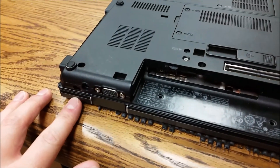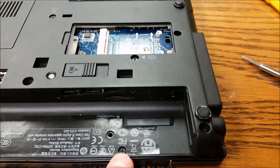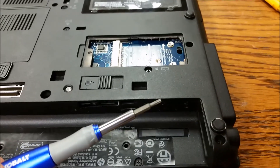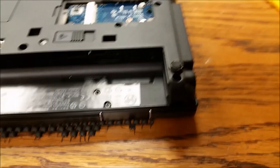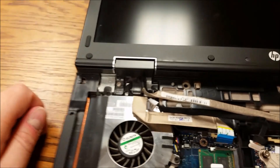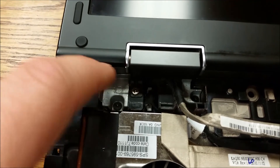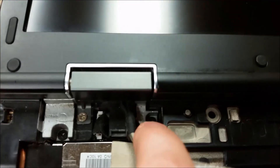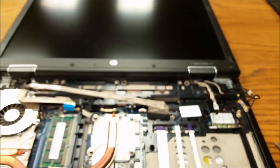Now that we've got this screw and this screw removed, we're going to get rid of this guy and this guy on the bottom here, and then use this Phillips screwdriver. Now since we're in the nitty gritty, get yourself a T8 Torx for these screws right here — I used them over here too. Once you've got the screws on the bottom out, flip it over, open it up again, and we're going to take out the hinge screws. They're easy to identify because of the metal right here. You've got one, one hiding up there, and one right there — three screws total — and then we take the head off.